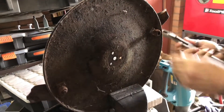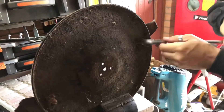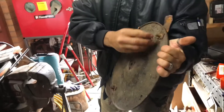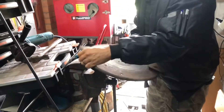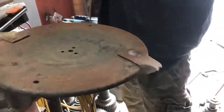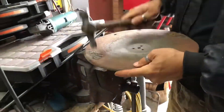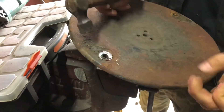Plus this lawnmower is a hundred years old — we picked this up on the side of the road. This wrench grips as it's turning, whereas the shifter just kind of rounds it. That one came off, so it's all pretty good. But this one will not budge, so we're going to have to grind the back off — it's the easiest way. Then you just grind it out and pull it back off.